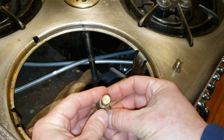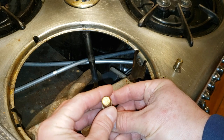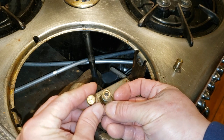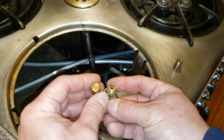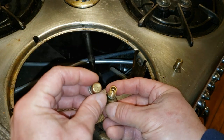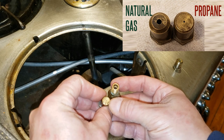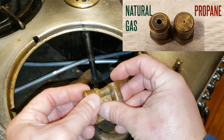Here's another option. This is also from a Chambers C, and if you look at that tiny little hole in the tip of that cap, this is just set up for propane. When we unscrew this, we see a different kind of jet — this is just a hollow pipe. The only thing restricting or governing airflow is the cap. If I want to change this stove from propane and use it on natural gas, I need to either replace the cap with one that's drilled for natural gas, or have the hole drilled. If you're a machinist or handy with machining, you can drill the hole yourself. Look up the specs to make sure you get them exactly right — it's all a matter of the cap.